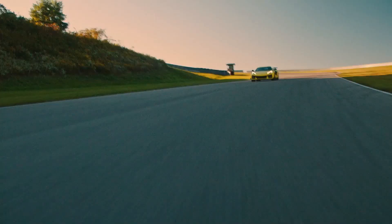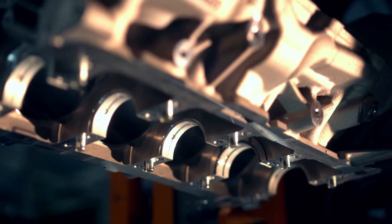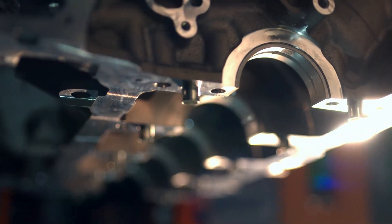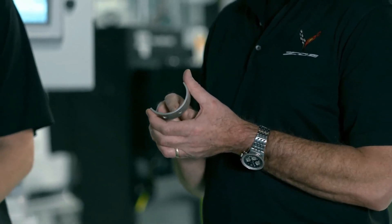There was an old saying: 'drive it like you stole it' — don't do that, that's a terrible thing to do. The biggest component you're protecting is the running surfaces, or the bearings. You need to give the bearings that first critical 500 miles. The top layer of the bearing is about 20 microns thick — a human hair is about 70 — so we're talking fractions of a human hair. As the engine vibrates through its orbits and gyrations, that soft top layer will actually move around and adapt to provide clearance, so you'll never have to worry about scuffing the bore of the bearing against the journal of the crankshaft.